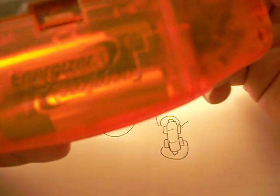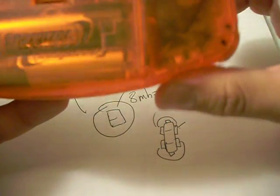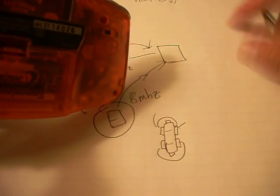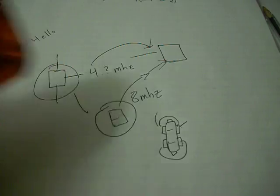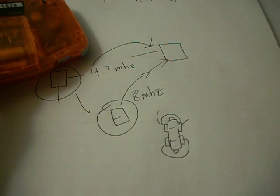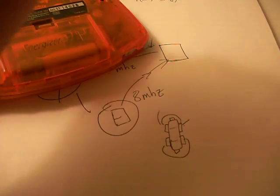That's an artist rendering with, usually it has 4 little solder tabs, 2 on either side. I'm getting very close to the microphone. Those, as far as I can tell, are linked kind of on the bottom, so they're kind of connected to each other like that, which means that connecting to this side is the same as connecting to that side. There might be tabs on top which are used for like power, but from what I understand, either side works fine.